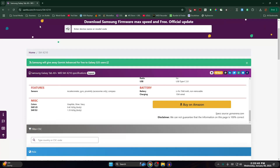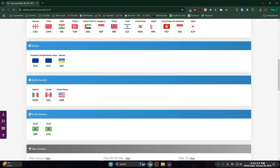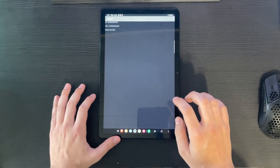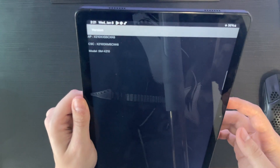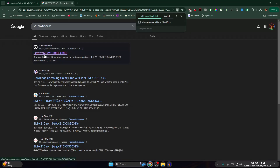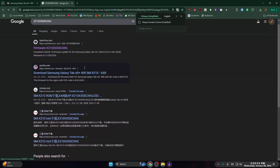The second step is on the computer. I'll put a link in the description, but we're going to be downloading the stock firmware for it — this is what we're going to modify to inject Magisk, and then flash it. I have the SM-X210 model. We need the CSC — mine is XAR. To check yours, go to your phone app and dial *#1234#. It will show your CSC right there. If you look on the computer and it's not obvious, the easiest way is to just Google it — click the first couple of links that match.